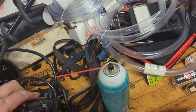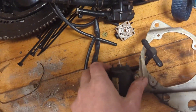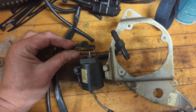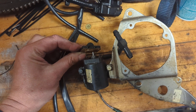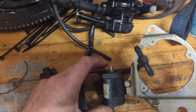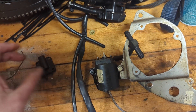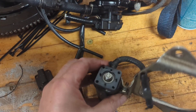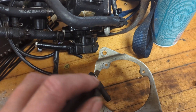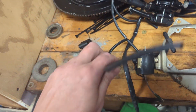Little lines go to the back of each intake. This is one I took apart for you — the cap goes on like this. When you push the key in, it energizes this purple and white lead, which energizes a solenoid. That just pulls this in and opens the valve from the large feed hose — it feeds fuel to these little lines routed through the motor, and shoots raw fuel into the engine.